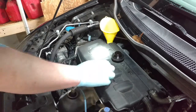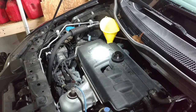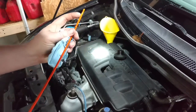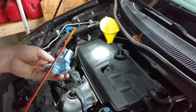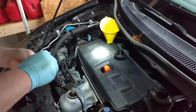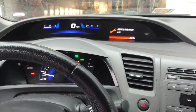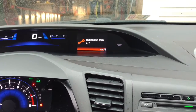That's over four quarts right there. This is your dipstick. Now, this is still on ramps — you want the oil to register on the dipstick before you start it and remove it from the ramps, because you don't know how much oil is in it. That's about right there on the dipstick. Once we start it and remove it from the ramps, it will probably go a bit lower, and we'll just top it off as needed. To reset the maintenance reminder — that little annoying thing — A12 is oil change and tire rotation.